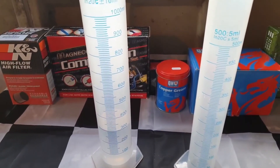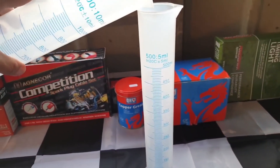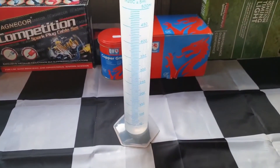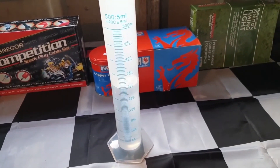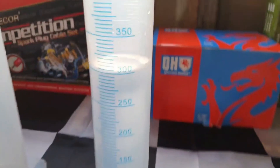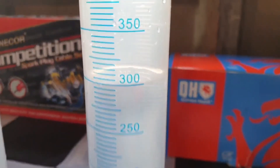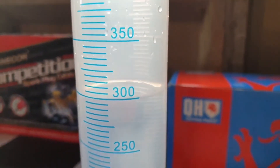However, the positive of hydrophilia means that we have a method of extracting the ethanol from the fuels using water, should we not have the option of buying ethanol-free petrol now or in the future. The 700 to 300 millilitre ratio of petrol and water will change if there is any ethanol, i.e. the level rising above the sharpie line in the last videos, or above the 300 millilitre line in the following videos.